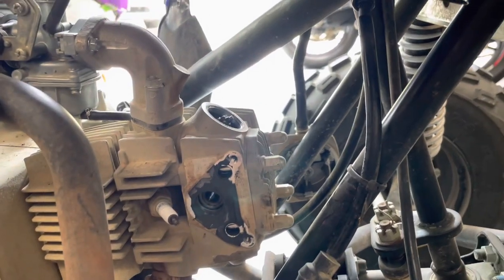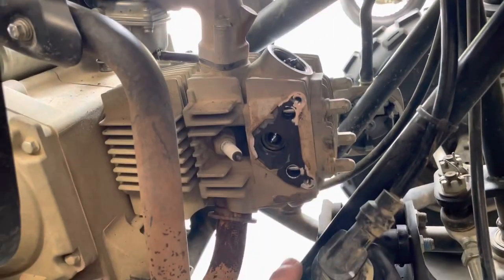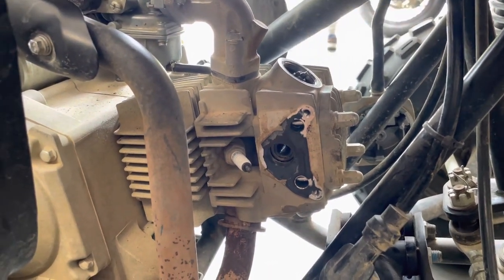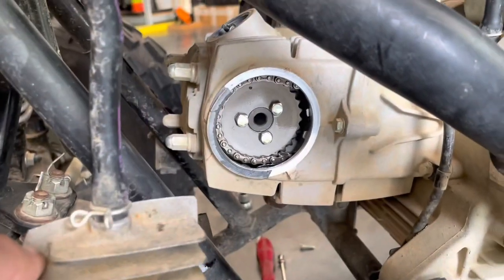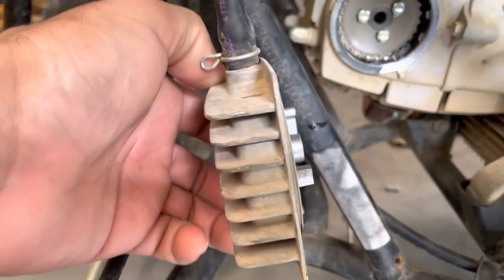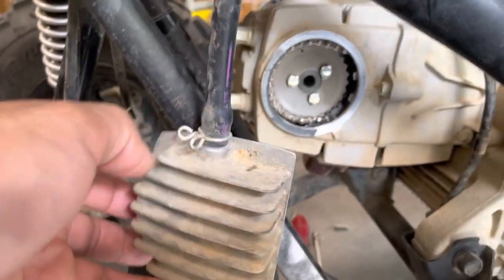You're just going to pull it off. You can see it hanging back there, and then the valves are actually on top here and on the bottom here, so you'll need to remove those caps as well. Once you pull the three bolts from the right side you can pull this cover off, and as you can see the gasket ripped, so be ready to replace those. I should have ordered both gaskets — they're just paper gaskets and they both ripped when I pulled the covers off.